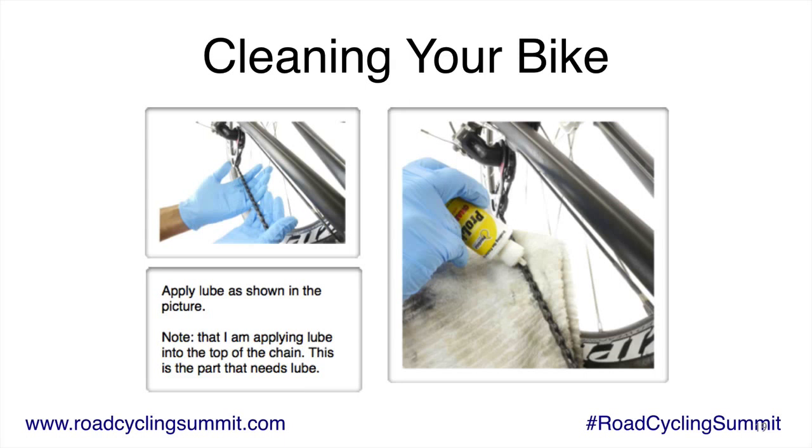But you can also just kind of go down the line. If you have a spray lube, it's the same method. It's going down into the chain, not from the side. The side doesn't need lube, the inside of the chain does.